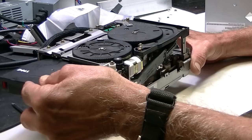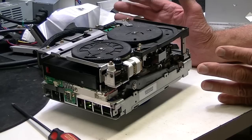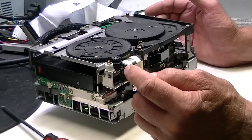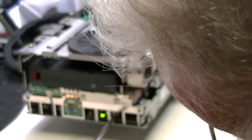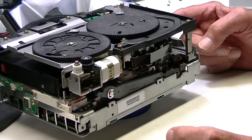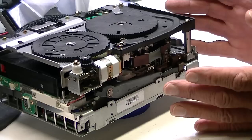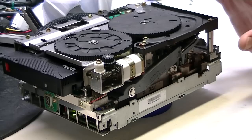This little wiper comes up and down and cleans the head. I'm going to do this one more time — it's going to take a little while to load, but what we're seeing is what's happening with these gears. They're slowly turning, the leader pin comes across, and it looks for the beginning of the tape. Watch how this little gear on this motor spins — this shaft turns these other two gears and then turns the larger shaft. Once that happens, the take-up spool spins until it gets to where the leader and pin are housed, then this gear starts to turn, pulls it across, and ejects the media.